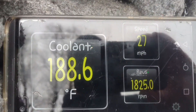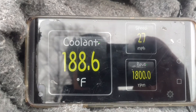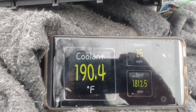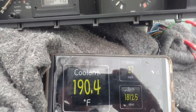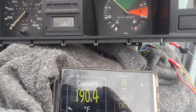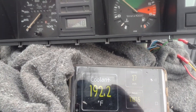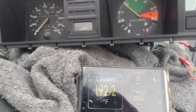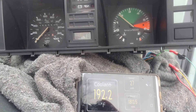You'll also notice we've got the speed sensor — it's reading 27 miles per hour. There's a microprocessor in the interface board with a program that turns the RPM into a speed sensor signal. It's a good enough signal to make the ECM and cruise control happy, so you're not relying on an axle-mounted proximity sensor that wasn't made to be outside and has a high failure rate, or even the ones in the back of the speedometer, which also seem to have a high failure rate.